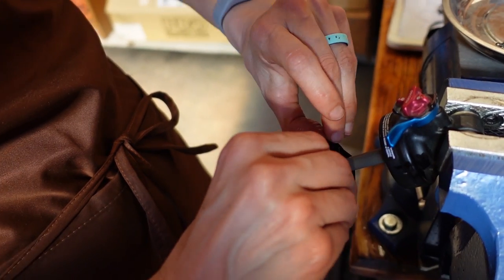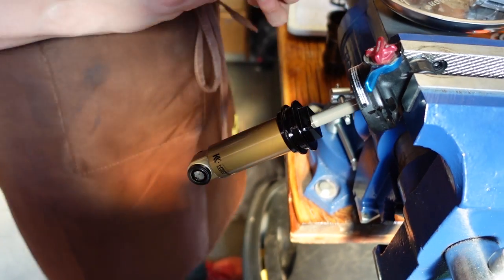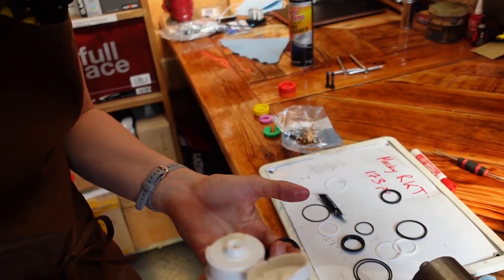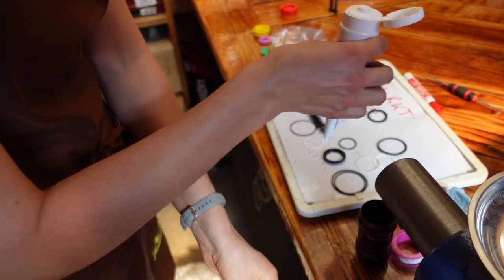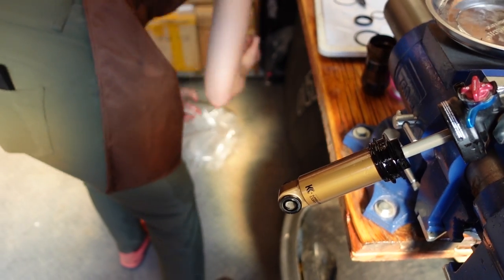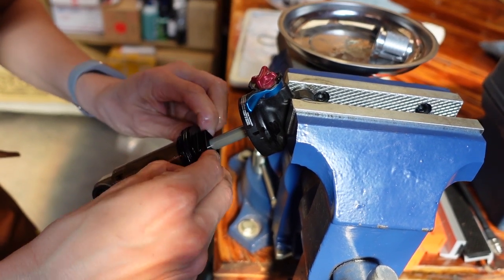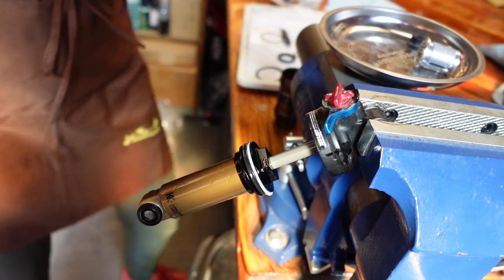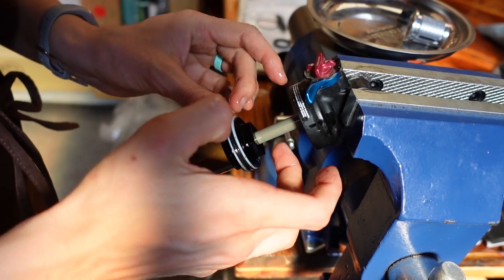This shock actually seems in pretty good condition. I kind of thought it would be dirtier given what you've put it through, but I suspect the fluid has broken down somewhat. So we replace that with Slick Oleum. I would probably put the black one in first — it'll just be easiest. I didn't think this was that watery. I put it in a container last time like a smart person; this time I'm living on the wild side. The wild side didn't pay off for me. Let's be slightly less klutzy this time.